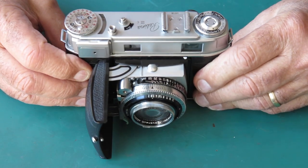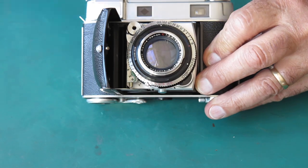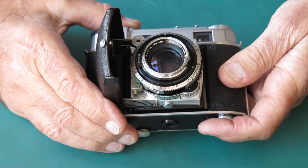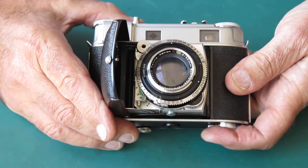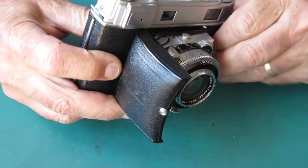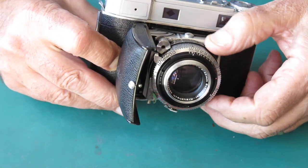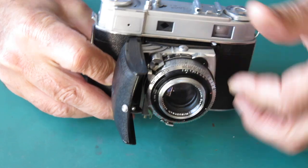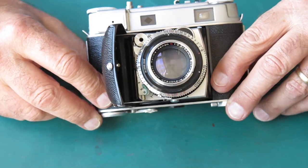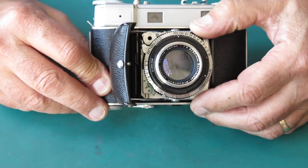Its mate, this is slightly later. And this one, what's it say about this? Shutter does not fire. Okay. Makes a weak click, doesn't actually fire, the blades never open. Looking at the position of the cocking rack, the curved rack in there, I suspect maybe that cocking rack's jumped a tooth or something and it's not quite cocking all the way. But again, we'll find out.